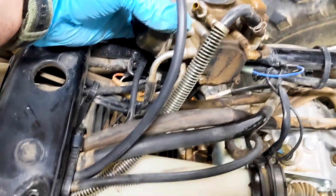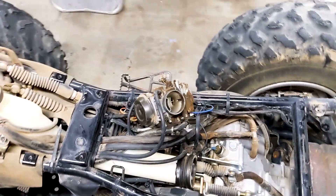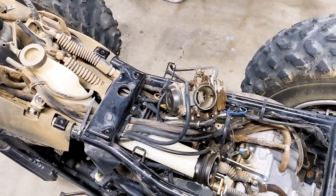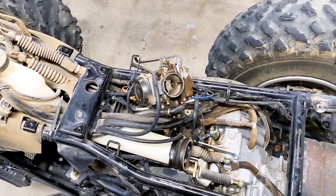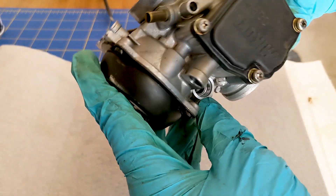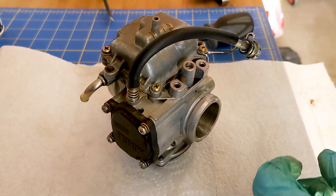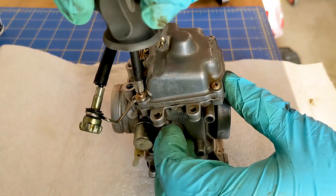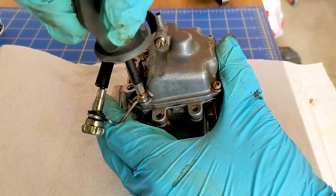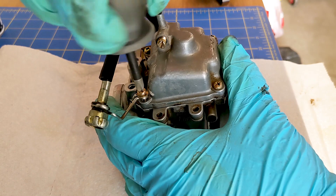Here's the side where the throttle cable goes in. I got to put this thing back together when I'm done and I don't want to forget anything. So if you ever work on stuff that you're not super familiar with — that you haven't done three or four times in the past — take good documentation so you can put it back together. I just washed off the outside of this carburetor; it was a lot dirtier than this. What we're going to do is clean out the jets and the passageways so the thing's super clear and will run like it was brand new.